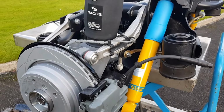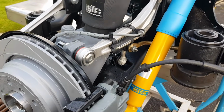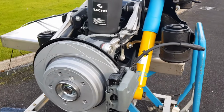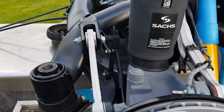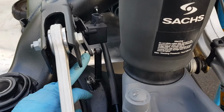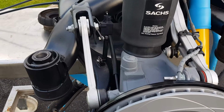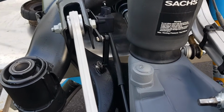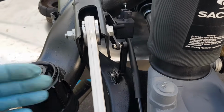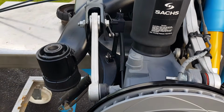And the suspension, I've shown you detailed part numbers for the suspension arms, bushings and all that. They're made by Febi Bilstein. So yeah, I had to put new arms here on the sensor for the self-leveling suspension. They were snapped and completely full of dirt. I don't like the way they have been positioned, so they gather all the dirt. If they were positioned the other way around, it would probably be much better and they wouldn't gather as much dust.